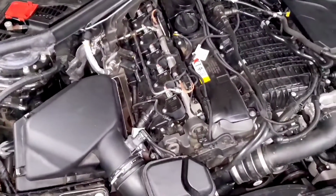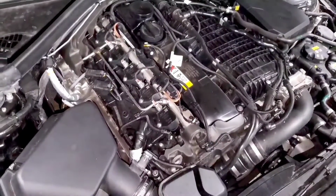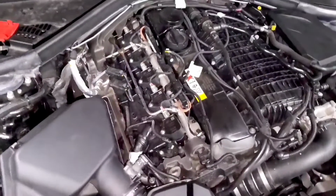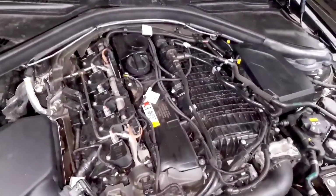Like I mentioned in my fueling video, the combustion pressures can be extremely high. So you need that elevated fuel pressure in the fuel rail to compensate for it so that the fuel can spray and distribute evenly. So look at your targets, look at your actuals, and if you see any dips in the rail pressure, that can be a cause for concern.